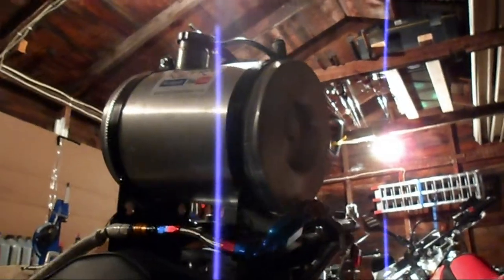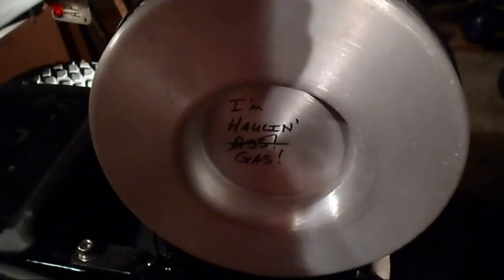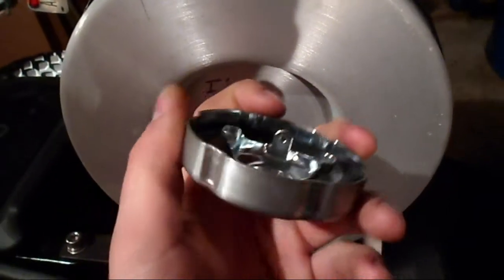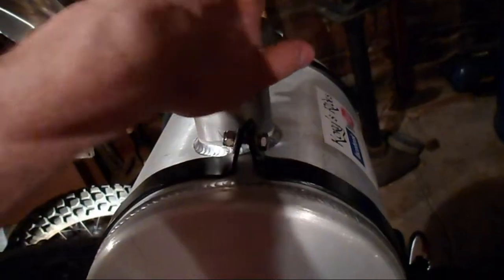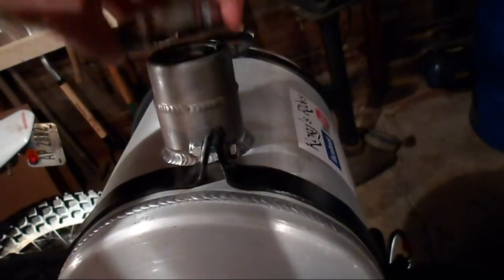You can get vented caps for these but I wanted to be able to route it away from the bike so that anything that vented would be out here, away from anything where gas getting on the seat might eat it up — gas getting on the paint will definitely eat it up. So I just wanted to avoid that, so I got a sealed cap and I had that vent line put on. That is the sealed cap. There is a little tab here that you could put like a little chain on and then the t-bar so that you can just take this off and drop it and it will just hang there. That is something I am going to do eventually when I find some thinner stainless steel chain.